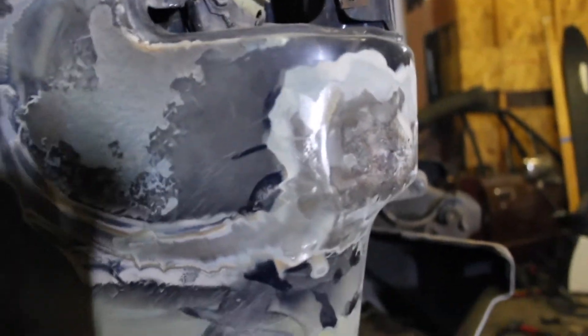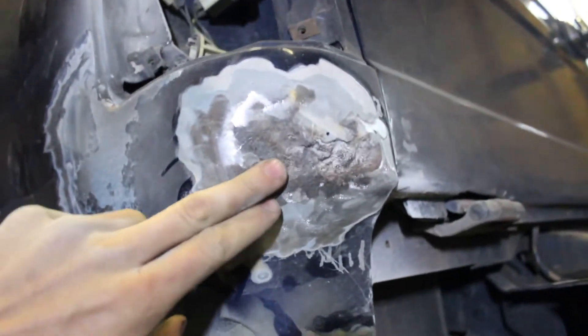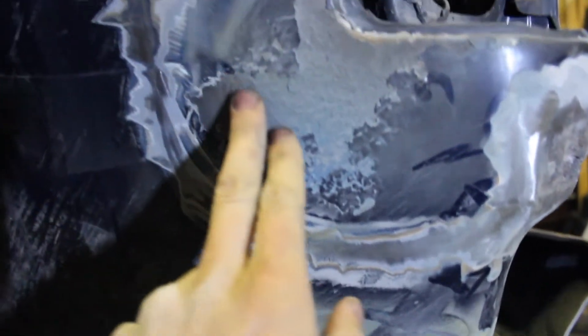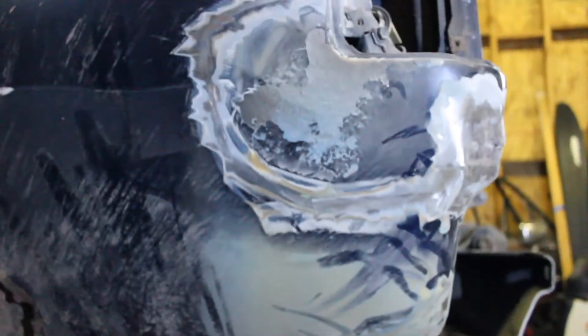Here's the reason I'm saying cut your body before the panel — back here I just found a huge rust spot. It was just two very small bubbles of paint; I almost couldn't tell, I just felt them with my hand. I took the grinding disc to it and it just started going through a lot of bondo. It looks like somebody backed into a pole or hit the corner of the truck, caved it in, and just filled it with bondo, smoothed it out, and painted over it. I want to replace it and find all the rust while I can. This piece looks like it's all solid metal right about there, and we have our solid metal line over there. There is a bit of a rust hole down in this corner, and then it looks like solid metal right there — so that's probably what I'll end up cutting out for this tail light area.